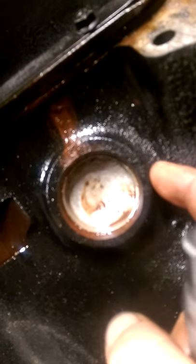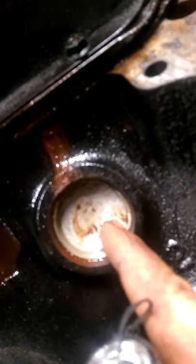Take a screwdriver with a hammer - you don't have to pound on it, because the cooling jackets for the pistons are behind there. If you pound in there too hard you're going to hit those jackets. So put the screwdriver not on the outside lip, but on the inside lip where they meet - where the integrity is on your hole - get a little hole started, and then you can take the screwdriver from there.